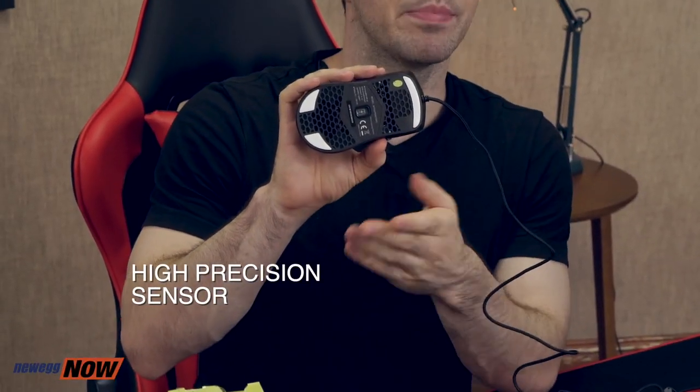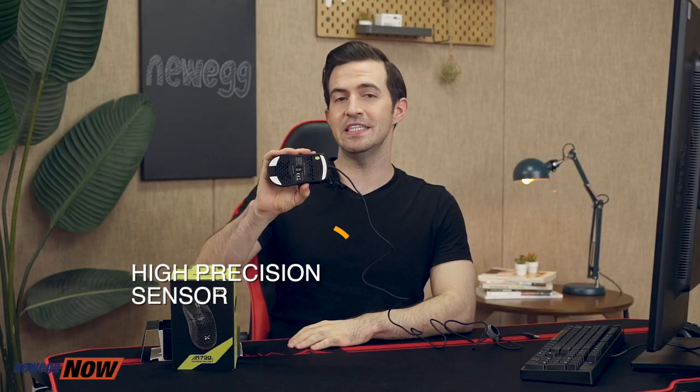On the bottom we have our high precision sensor. You get up to 16,000 DPI with this baby. Using the DPI control buttons, you can toggle between 1,000, 2,000, 4,000, 8,000, and 16,000. The sensor has up to 50 G's acceleration, 400 IPS (that's inches per second), and a 1,000 Hertz refresh rate. For FPS gaming, you probably don't want your DPI set too high because even slight movements at 4,000 plus DPI will make your gun fling around like crazy. A lot of pro gamers will opt for a light, ergonomic, smooth mouse just like this one, and maintain one of those lower DPI settings for extra precision.